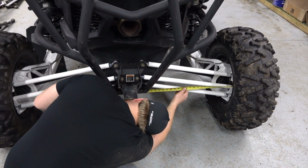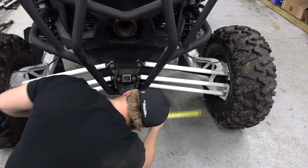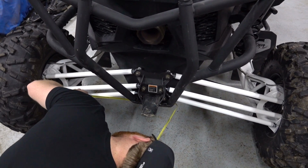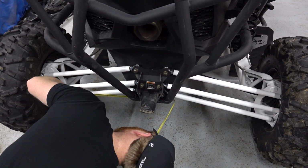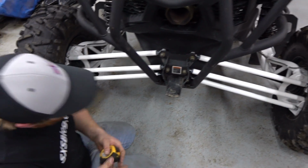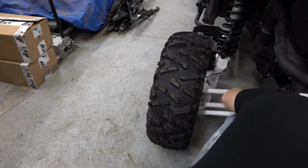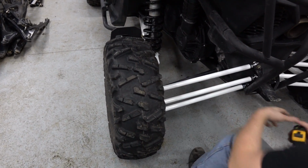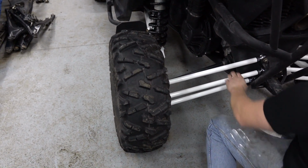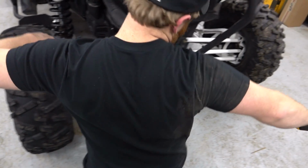Yeah. And we'll see. So yeah, we're about 26 and... no, we're about 26 and 5/8. Okay. And about 26 and 9/16. So wow. We're close. Super close. Give her maybe a little more tweak. Yeah, we could use a bit more toe anyway. Okay. Maybe if you just toed that one to 5/8. Sweet.